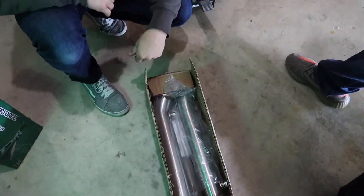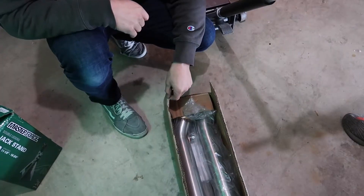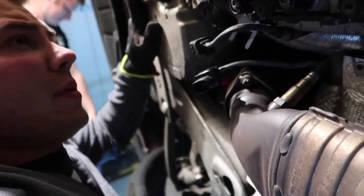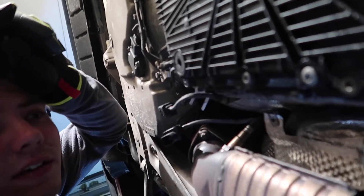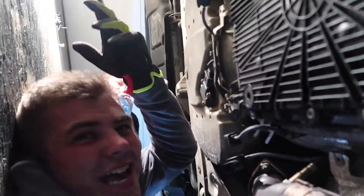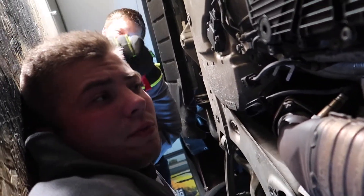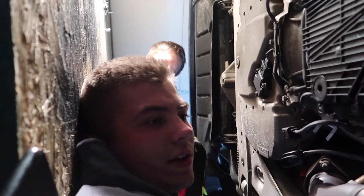The install looks relatively straightforward — we just have to drop the mid pipe, cut the primary cats off, and bolt the test pipes on. We are underneath the car removing clips for the O2 sensors. You have to remove the main undertray and then the heat cover for the DCT trans. I also found out I need a trans service done — the cover is leaking, which is a common problem. I'll order a new cover and take it to EP3 for the service.